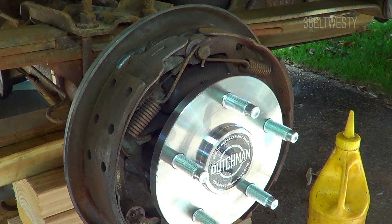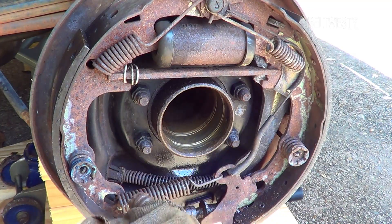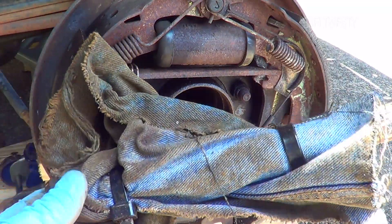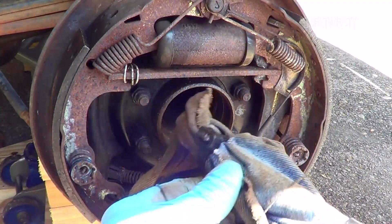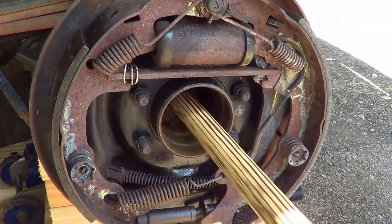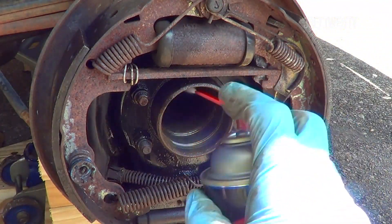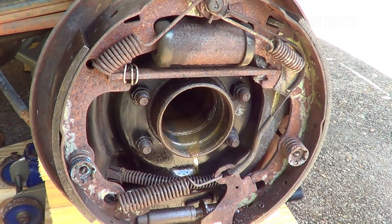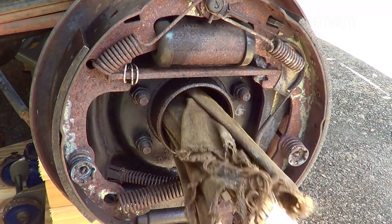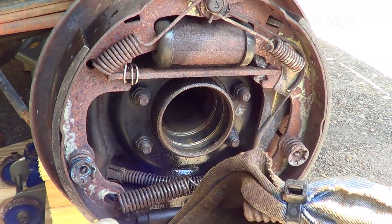This is a seven and a half inch Ford rear axle and the other side failed. I had a bunch of junk in it. I've got basically a broom handle and two tie wraps hooked up to a piece of old blue jean rag with a hole through each piece so it doesn't tend to come off. I was in here swapping this out — the other side was way worse than this. This had just some superficial stuff. I got some brake cleaner squirted in there. This is actually sloped downhill which is a little better, just trying to get all the stuff out. That's all the crap I've got out of there.